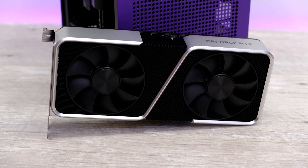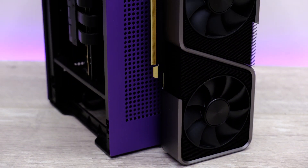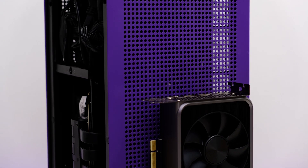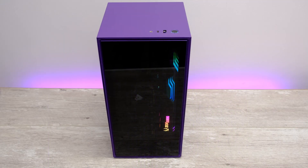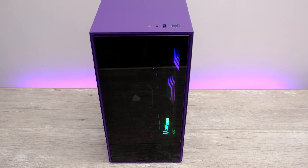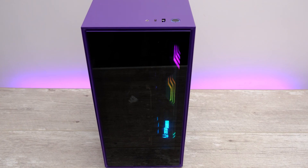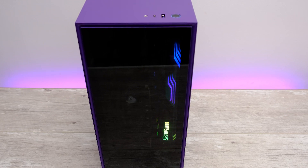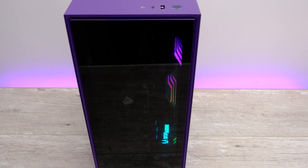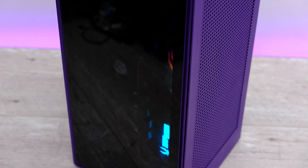It's fairly clear that the best way forward with the NZXT H1 is to go with a partner card — something with the biggest cooler you can fit into the case with the biggest fans. That seems to be the way to keep thermals in check with these new high-end cards in a relatively compact case. My advice is to go for the biggest, most powerful cooler you can, whether you're going for a Radeon card or the new RTX 3000 series. You can check out the Zotac RTX 3070 Amp Holoblack dimensions — I'll put a link in the description — as those are the dimensions you should be working towards for the biggest card you can fit.